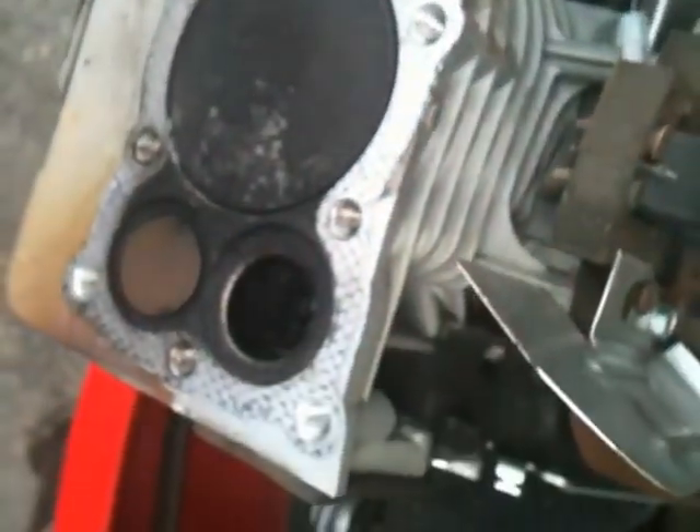What you could also do is just put a rag over there. As you can see in here, a little gunk got sucked up from the carburetor and got inside there, clogged this up, clogged up the hole that it slides into. So I'm just going to clean that out. You can see here — cleaned out the mating surface which seats. Also, to get the spring out — there's a little clip. All you do is push the spring up with the screwdriver and it will just pop right out. You might have to finagle with it a little bit, but once you get it, it's really easy. I'll get back to you as soon as I clean the intake out.